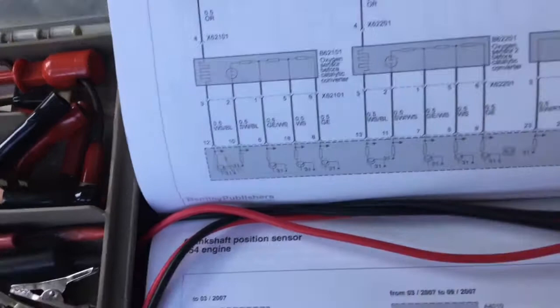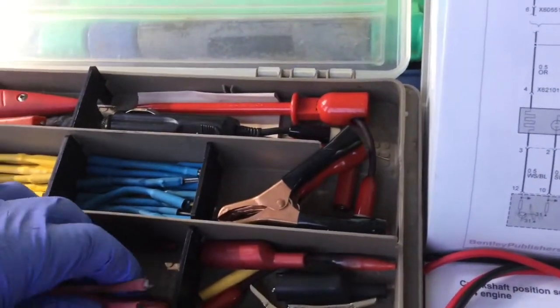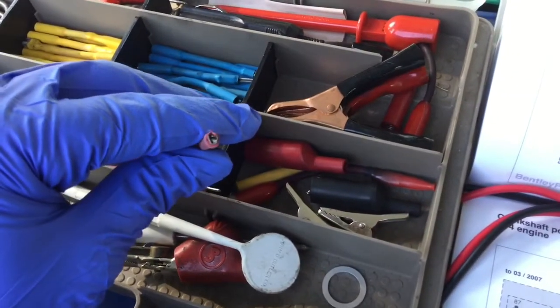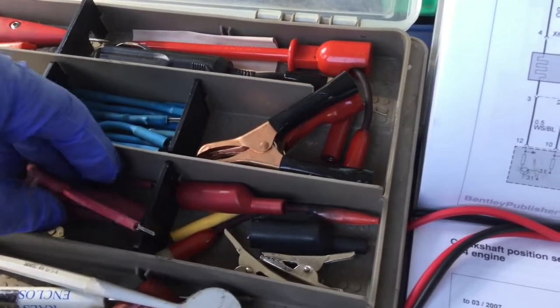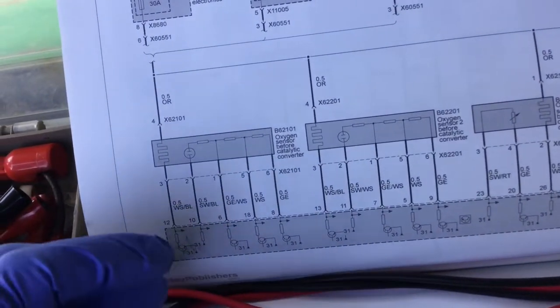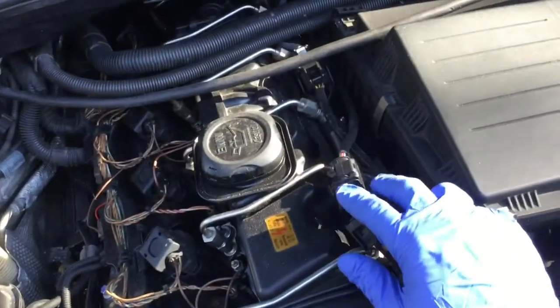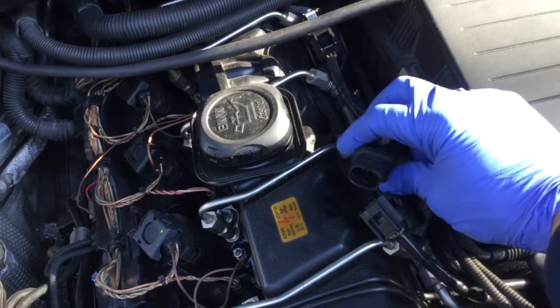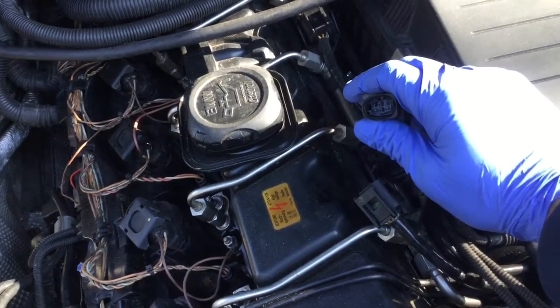So in order to do so, we'll get on the car and we'll see how we go. I have a couple of things — like this thing here — you can pin on the sensor connector. When you want to check resistance, you have to unplug. The sensor needs to be free; it has to be standalone. So I'm unplugging the connector. The one up front is the one for Sensor 1 on Bank 1.